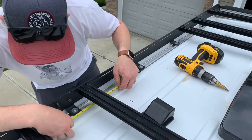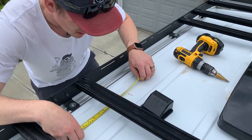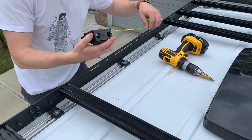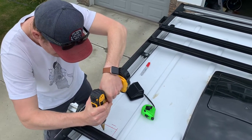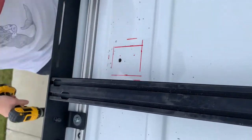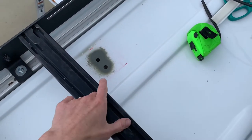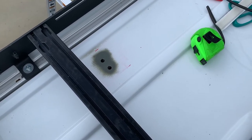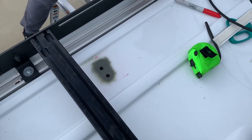We're confirming our measurements to make sure we have enough space between the cross members for the wires to be run inward toward the wall, and then along the rest of the wiring assembly inside. After finalizing measurements, we drilled — that's our third set of holes going into the van. After feeding the wires through, we decided to make the holes a bit bigger since there was too much tension on the edges and we didn't want that sharp edge closely resting on the wires.